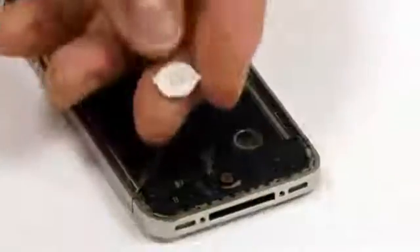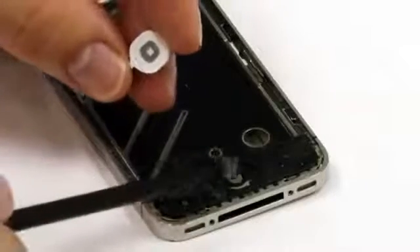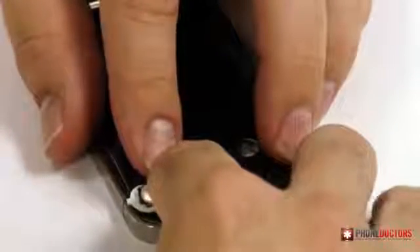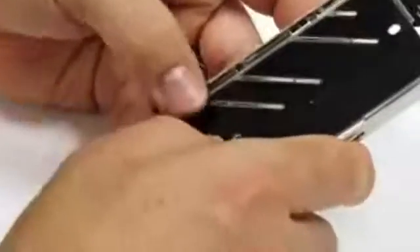Now we'll go ahead and put our white home button on. If you turn it over you're going to see a little plastic indention — a mold that is the exact cutout for the shape of this flex cable. We want to lay the home button straight onto the middle housing, then take the flex cable and gently push it down right on top of the imprint in the home button so it sits accurately. After that, fold it back over into placement and make sure the home button square is straight — you don't want it to be cockeyed because it's going to look funny when you put the LCD on.